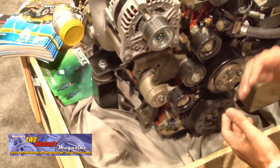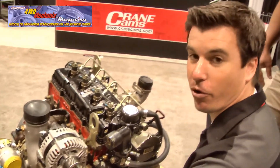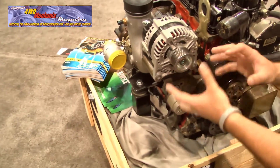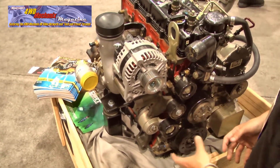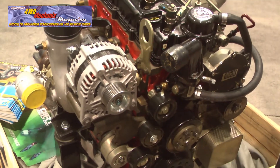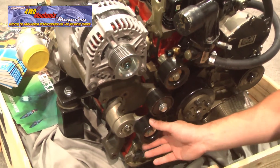For the crate engine program we'll probably start with one or two universal applications, and the aftermarket will be able to bolt right on here with relative ease — there's nothing bolted to the face of the block, just these four bolts on the side. For more specific applications the mega bracket may not cover, they can adapt with a lot of ease. We're running an eight-groove pulley system here for a serpentine drive belt, with a belt tensioner very familiar to Cummins customers.